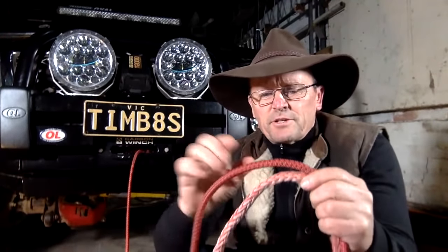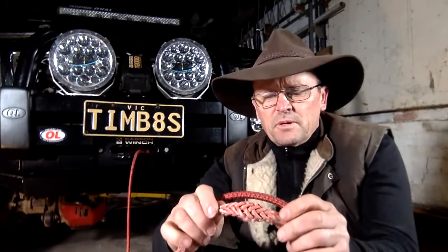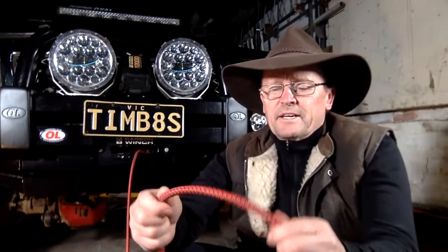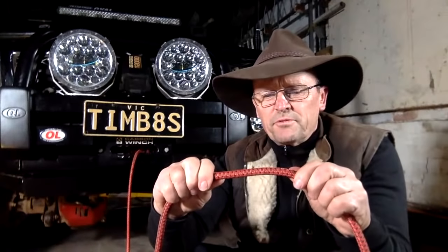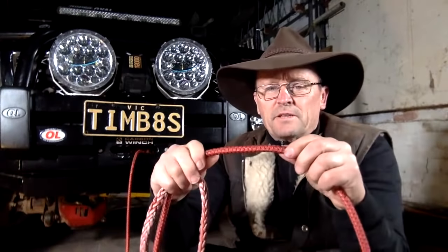There are some big differences, but you've got to make sure you wash the standard synthetic rope out really well because the fibres can get damaged pretty easily. If you've got this style of rope on your winch, you've got to wash it out well and get that grit and grime out if you've been winching in bog holes and mud. Whereas this braided one is a lot more protected. From the sun too — UV rays can damage synthetic rope, but this outer core provides a bit more protection for your winch rope sitting in the front there.